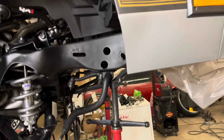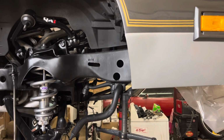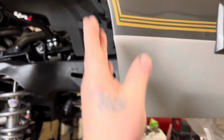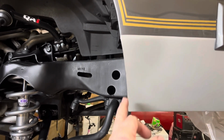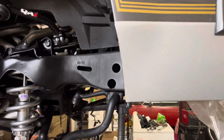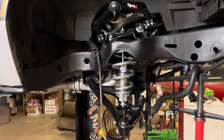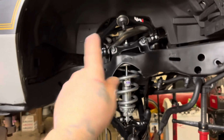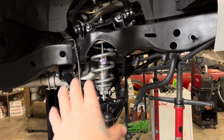I did trim both fenders. And he knew that it had to be trimmed, so it's trimmed. See how I didn't just whack it off like that. It got a little curve to it, which it didn't need. It probably needed to come down a little more. But that's the first trim. I degreed the spindles back. So when I degree the spindles back, you know, I'll put the shims in there. So we're gonna see exactly where it sits, and then I'm gonna measure my alignment setup.